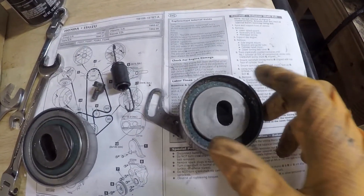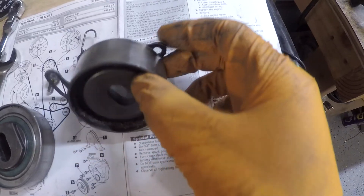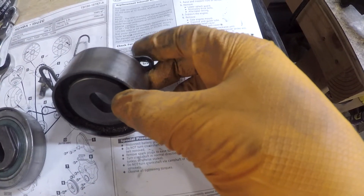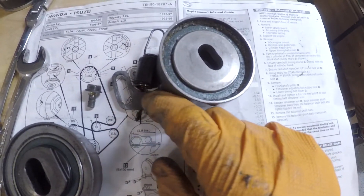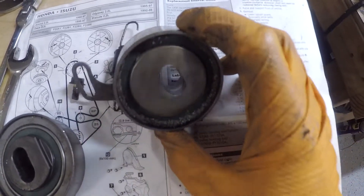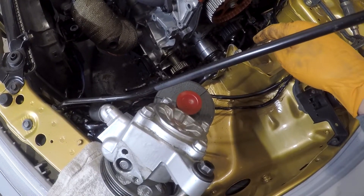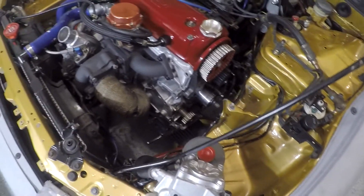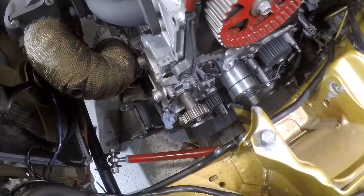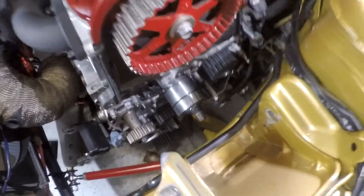It's been a while since I did the timing belt on this thing and I had forgotten — the main takeaway is there's a pin on the block side that goes in from the back into the pulley when you put it on. If you don't use it, the hole will only line up in the wrong spot. So that pin's got to be in. Now we're good to go — I'll get the tensioner loose, put the springs on, and start putting the belt on. I haven't moved any of the pulleys at any point.